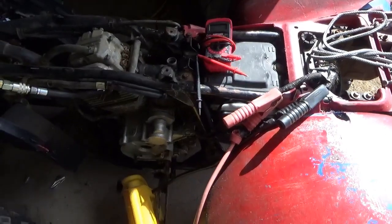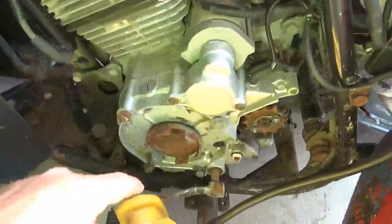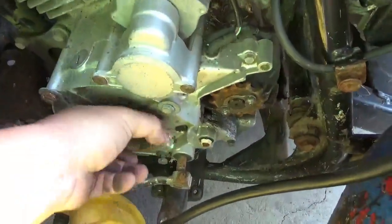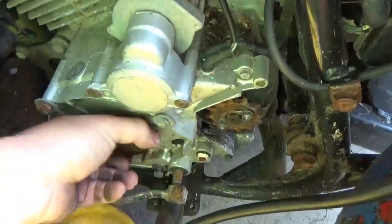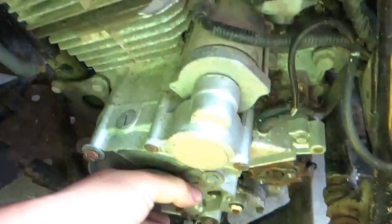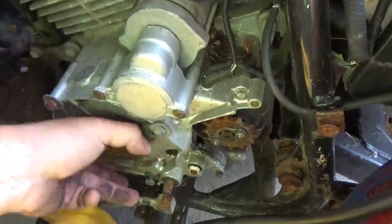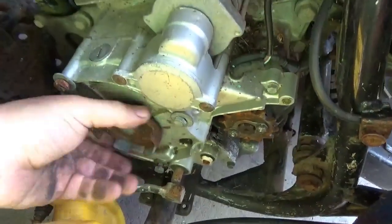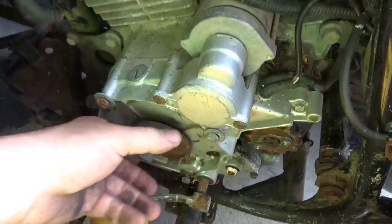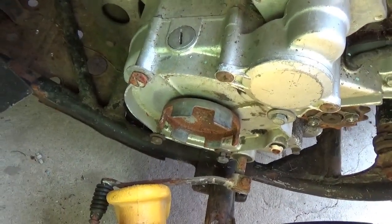Secondly, I like to make sure the engine has no obstructions. And you do that by giving this a quick turn with the spark plug out, right? And it seems to go round and round, and I don't hear any bad sounds. It feels like it's fighting me enough, so the valves are actuating. It feels like the piston is moving, so that's all good things.